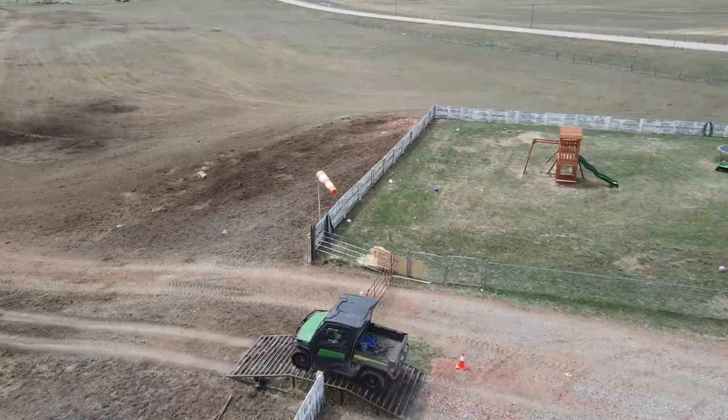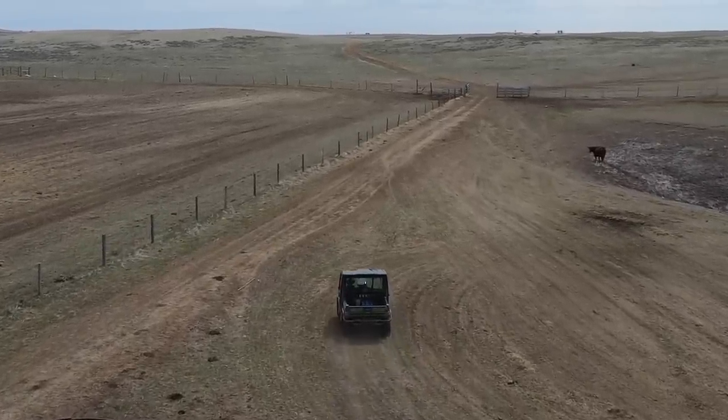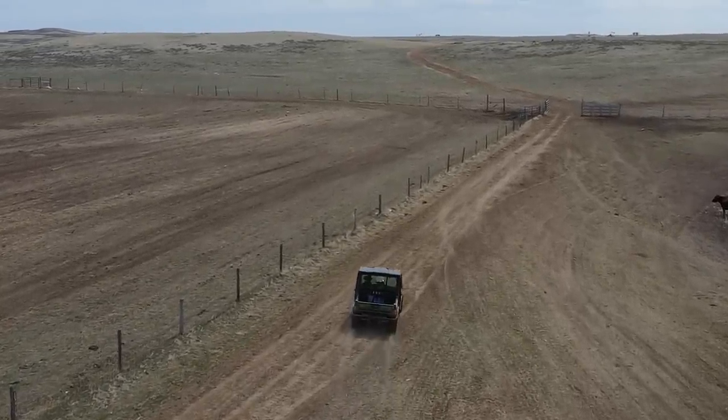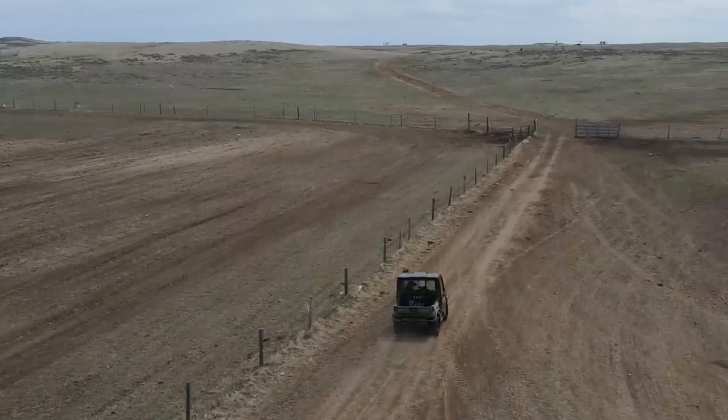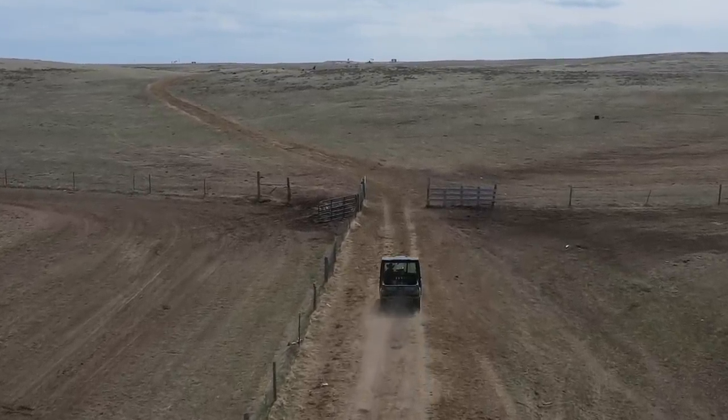First test — up and over the ramp. I've been used to driving on tweels with the old Gator for a while, but this really doesn't feel a whole lot different than driving on regular tires. You lose a little bit of suspension just because you don't have that squishiness of the tires, but you do have a little bit of flex so it's not exactly horrible. The ride can be just a little more rough, and turning is a little different because you don't have the bias of the tires to aid in the turning motion, but overall it beats a flat tire any day of the week.